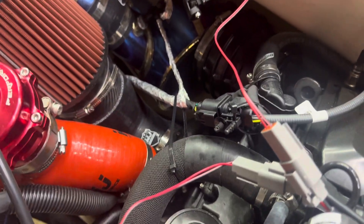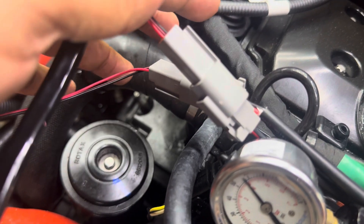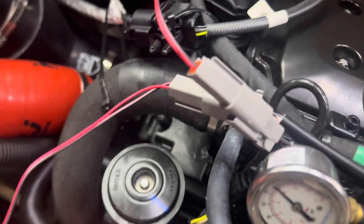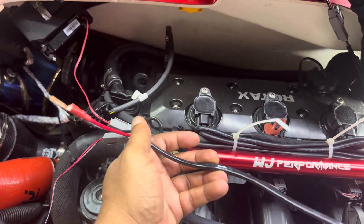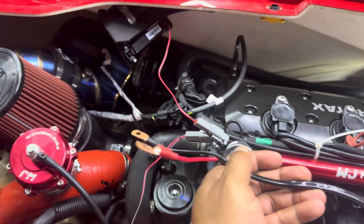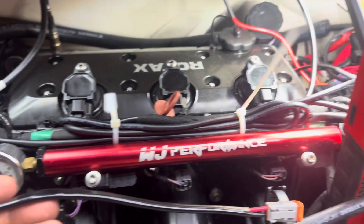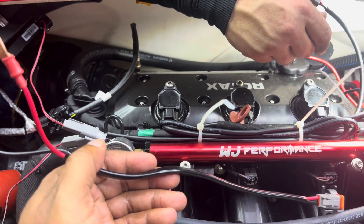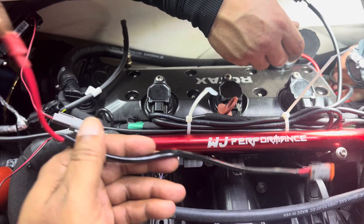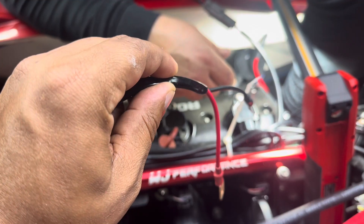Once you've got your pieces on with the silicone, all you do is take your harness — we already got it wired in — and for the rear ram air you'll just have two pigtails right here. You plug them up, and the harness runs all the way to the front where the battery is. Here is your jumper plug that you're going to put down on the battery. Hook it up positive and negative like so, then plug it up to the main harness. If you only have the rear ram air, you're only going to have a harness for two. We've got front and rear ram air on this, so we've got a four-plug harness. You have to zip tie it all down because all these harnesses will fit the RxPX, the RxTX, and the GTX — it's one main harness. Those are longer than the RxPX, so you'll have a little bit of extra slack to zip tie up. Plug this down at the battery, then plug it up to the harness, and we'll show you how it's all hooked up at the end, and where you're going to zip tie your remote control box up here at the front.